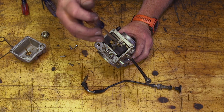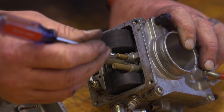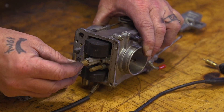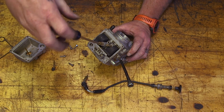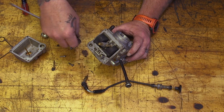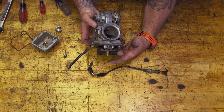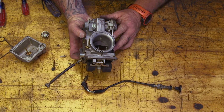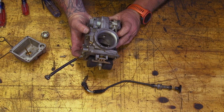The pilot jet is the smaller one — it's a little deeper down in here. When you put these in, they need to be snug, but they are soft, so be careful with them. The Mikuni has a main jet extender and then the main jet sits right in that extender. When you get on the throttle, the bike is being fed from the main jet, but the fuel is being controlled by that needle in the slide that rides up and down. That needle has some control over how fuel comes through the main jet.